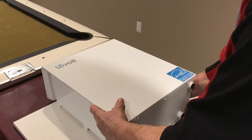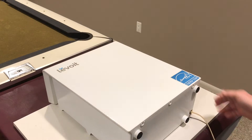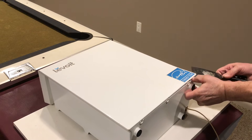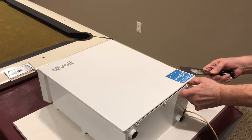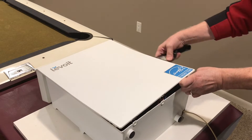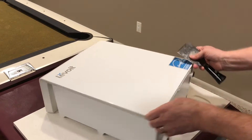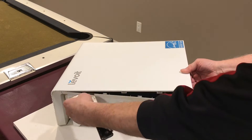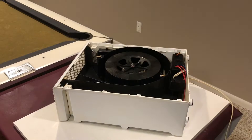With the three remaining screws removed on the back side, we've got it flipped over to the top. I used a putty knife to gently pry the edges up to loosen the tabs on either edge of that front cover. Once all the tabs are up you can see the front cover has a lip along the front edge, and once you've got all the tabs up you can gently pull that out.